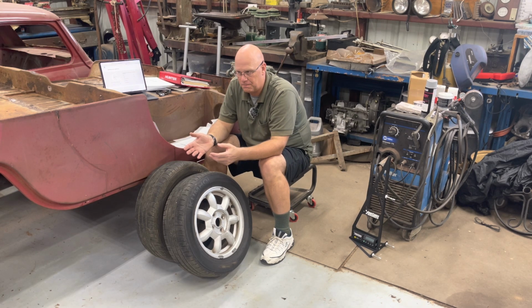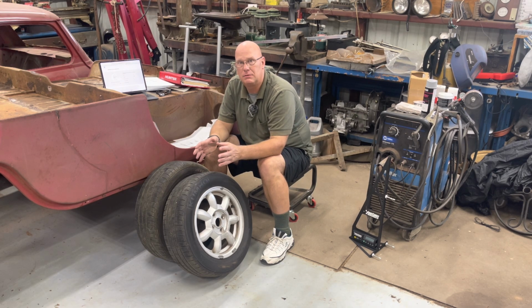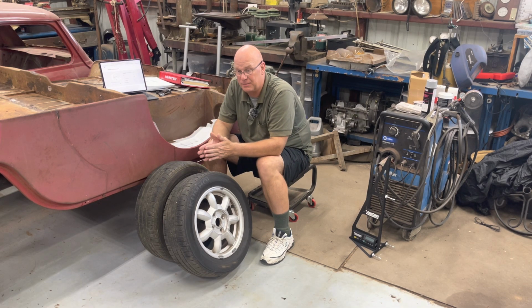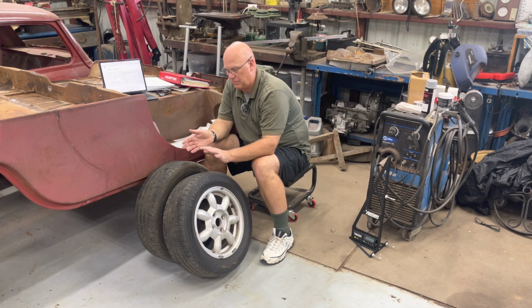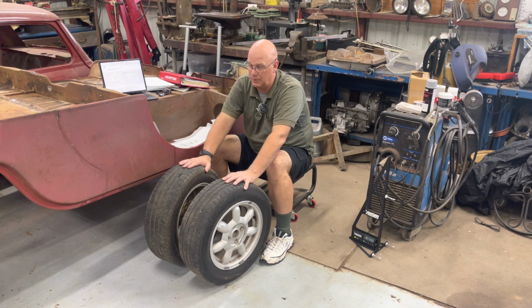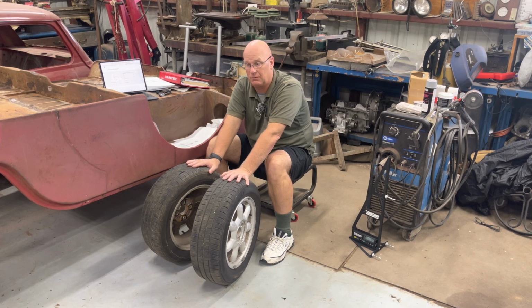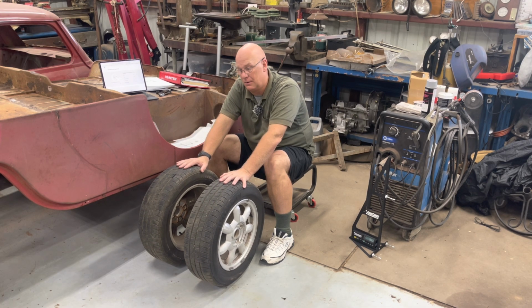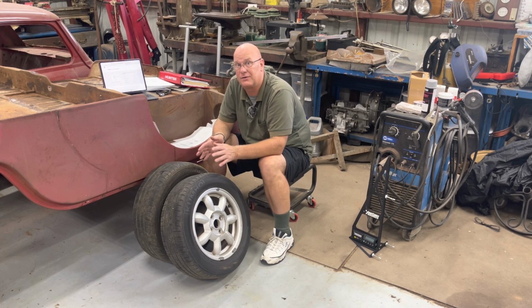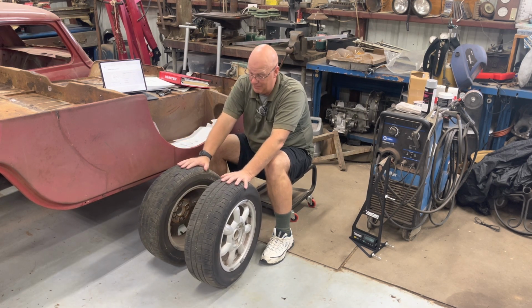And the weight of how you normally drive does matter for alignments. Now here's how alignments can get really expensive. Again, with the toe out for rear-wheel drive, toe in for rear-wheel drive, toe out for front-wheel drive cars, there's expected to be a little bit of movement. If a vehicle, no matter who made it, no matter how it's driven, has more than 30,000 miles, there's going to be more than 0.35 millimeter slop.